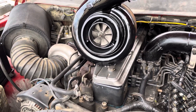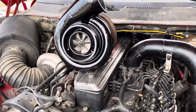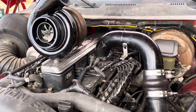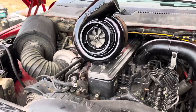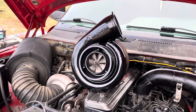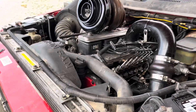As soon as I get a chance I'll buy some studs to put in it after I get my manifold and piping kit on it. I'm not gonna turn my truck up any — I got the AFC live turned down right now and I'm just gonna run it just like it is. Trying not to be too hard on it or blow a head gasket until I get a chance to put some studs in. This is probably gonna be the last build on this truck — about 700, maybe 750 horsepower is all it's really gonna want.